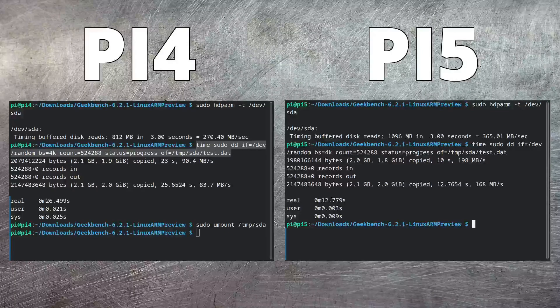With this USB thumb drive, it's really clear that the Pi 5 has vastly better performance. I think a lot of this is because the RP1 chip dedicated to I/O now frees up the real power of the USB 3 ports. In the Pi 4, all of this I/O was fed through the CPU, whereas the Pi 5 has dedicated hardware for it, and so it's way more performant.